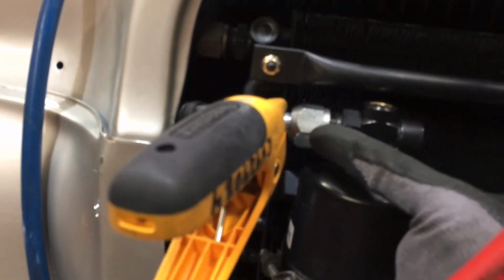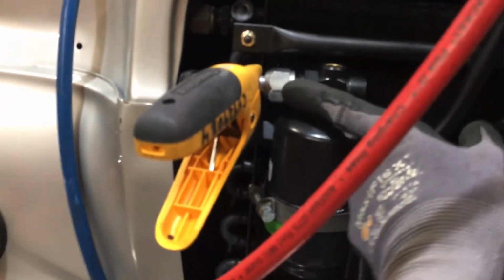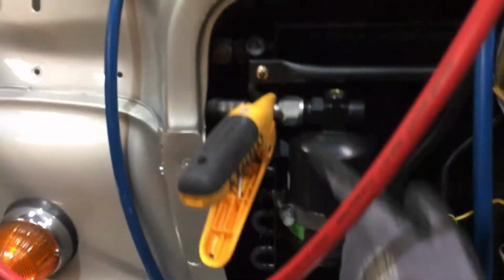Now at the lower portion of this receiver, there's a straw that goes all the way down to the bottom, and this fills up with liquid. That straw picks up the high pressure refrigerant. In this case, it's dry nitrogen that's going to be sweeping back up through the straw, and it comes out to this liquid line, and at this point it's almost a pure liquid. Theoretically, in ideal conditions, it would be.